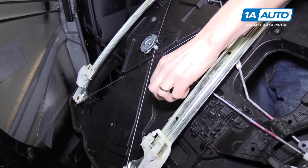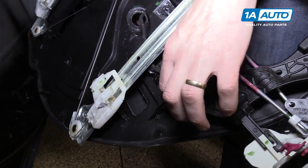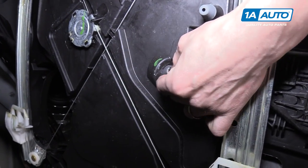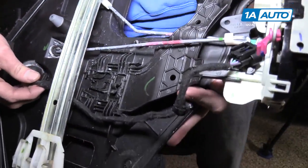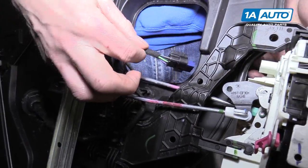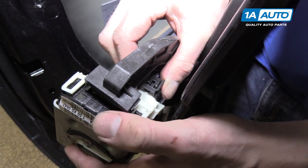We're going to feed the door lock actuator wiring through here and under the window regulator. We'll pull the rubber grommet through, then snap one clip into place and snap the other into place. This goes under here, this one goes behind — push that through this hole — and then up here we just have to clip it into the door lock actuator.